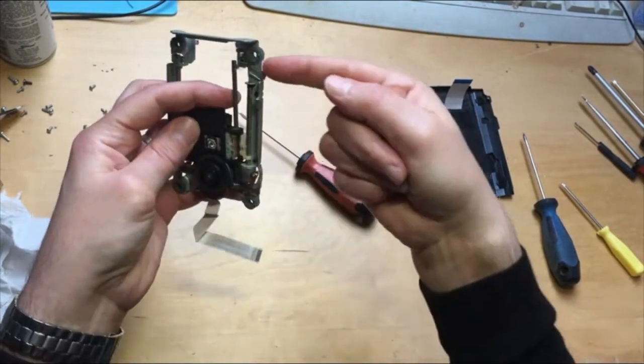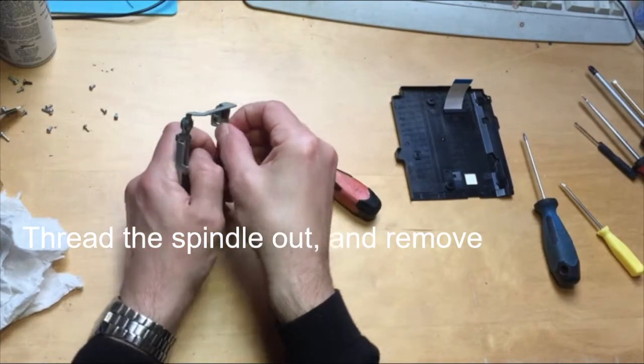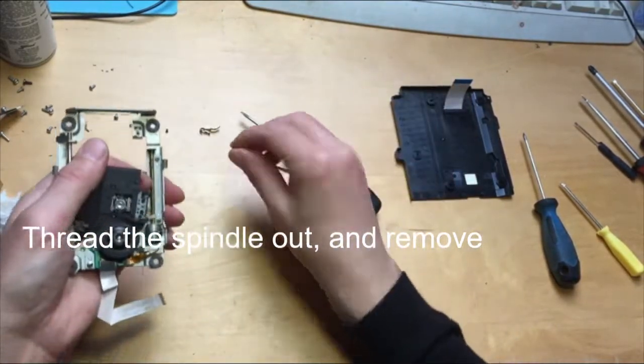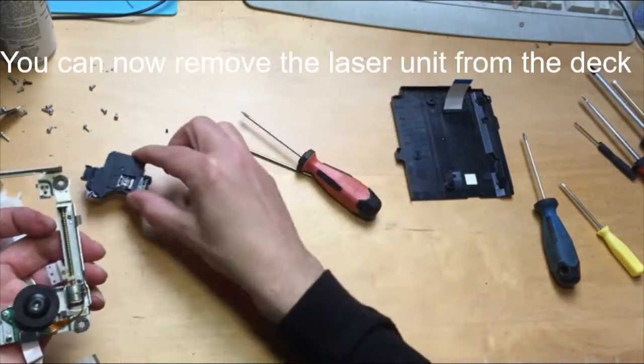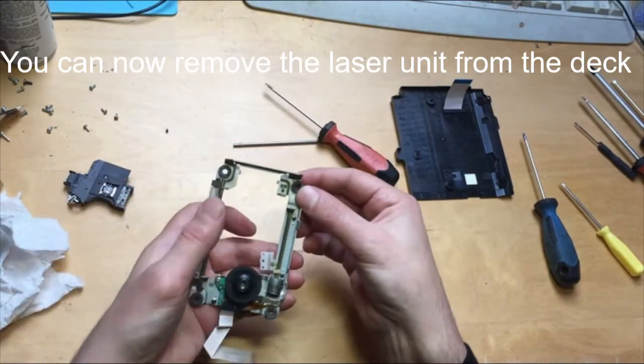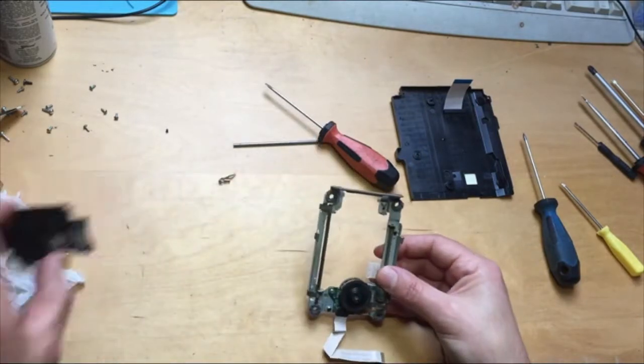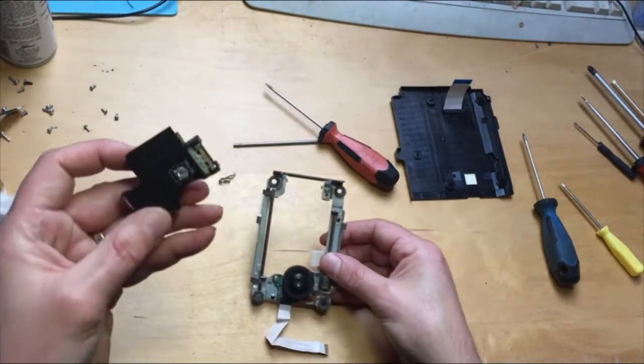and we've got this out of its home there, okay? Once we've done that, we can pull on this and the laser just falls off, okay? We need that clip, by the way, that just unclipped there. We're going to need that. So once you've done that, get your replacement laser.